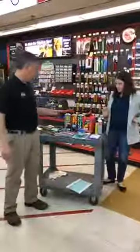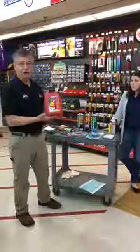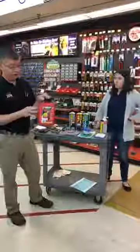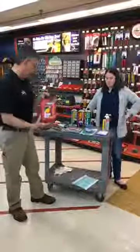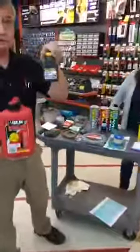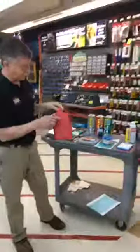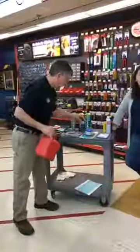If you're going to mix your own fuel for your 2-cycle machines, get a 1-gallon gas can. Try not to store any more than 1 gallon at a time. Two things happen: gasoline breaks down over time, and some of that gasoline can evaporate. The gasoline evaporates but the oil does not, so your mix gets richer by default. If your machine calls for a 40 to 1 mix, use a product labeled 40 to 1 — that means this bottle goes in 1 gallon of gasoline. The can will have a mark on it where 1 gallon is. There are some cans with a translucent strip so you can see through. Use a flashlight — stick it on the side.